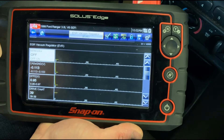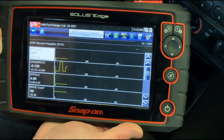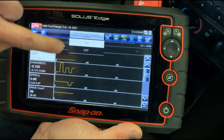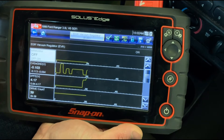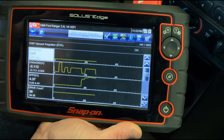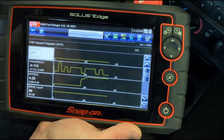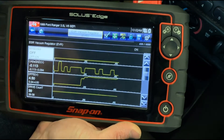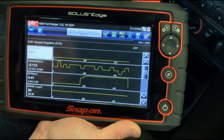The other test available on this Ford is the EGR vacuum regulator test where I can simply turn it on or off. I select the vacuum regulator and hit on — the idle really comes down and I can see the DPFE sensor voltage go way up. Those two things together tell me the valve is functioning and the passageways can flow, because I see a decrease in idle quality and I see the DPFE sensor register flow. Turning it back off, the DPFE drops and idle quality is fully restored.